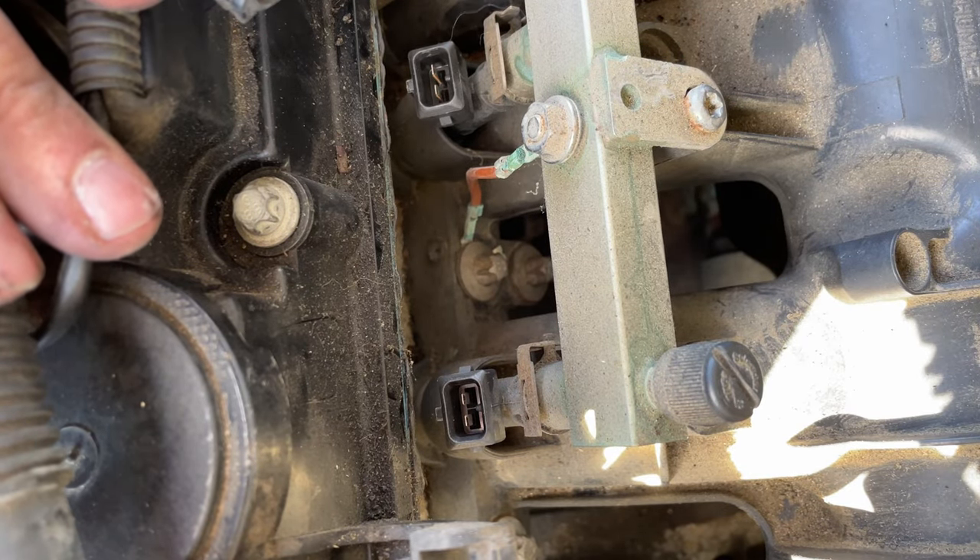I have it running. You can check your valve here — it's not making any noises, no vacuum noises when you put your finger over it, so you know that's good. Hopefully it would be since it's a brand new valve. Just check around the valve cover to make sure you don't have any oil leaking, and double check all your connections so you don't have a vacuum leak. I hope you found this video helpful on how to replace the valve cover, the intake manifold, and the PCV hose on the 2011 to 2016 Chevy Cruze, Buick Encore, and Chevy Sonic. If you have any questions, feel free to let me know. Thanks for watching.